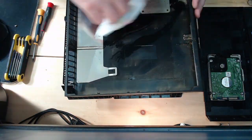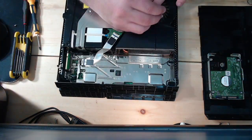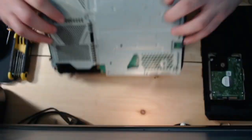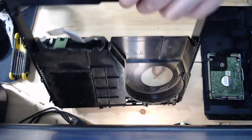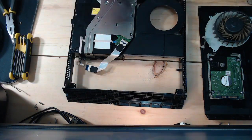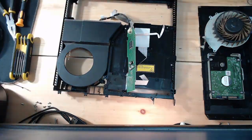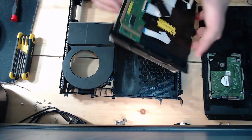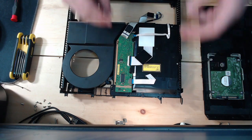So to make sure that I got all the cracks and crevices clean, I went for a complete teardown of this system. Luckily not finding any traces of bugs or cigarette smoke or anything like that, just some old orange dust from age. Most of the parts were cleaned individually off screen. I used isopropyl alcohol for anything with electronic components. When it came to the bare plastic shells, I took those straight to the tub and used hot soap and water. I made sure those were completely dry before returning them. And for the grimy cooling fan, I used cotton swabs and IPA alcohol.